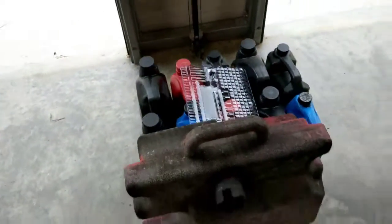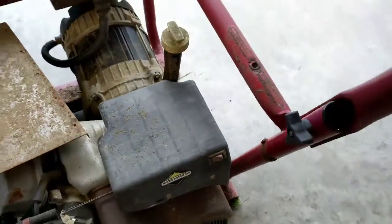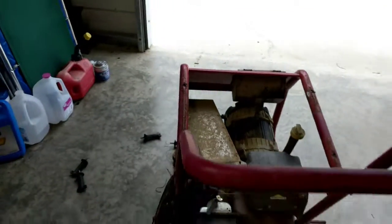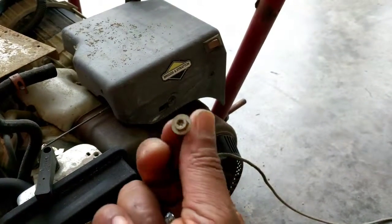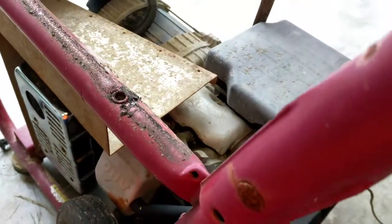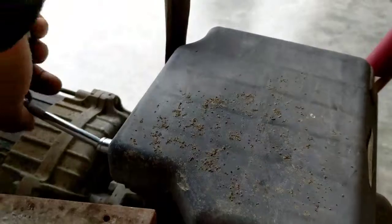So the tank has its own personal jug. I'll go ahead and take this off — just two screws right in there and two on the back, then this comes off and I can reach everything else. The screws up front you can use a five-sixteenths or T25; the ones on the back are three-eighths, so a short extension would work on both. I'll go ahead and take the cover off and then go to the next section.